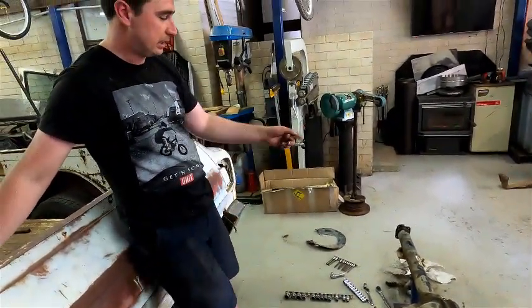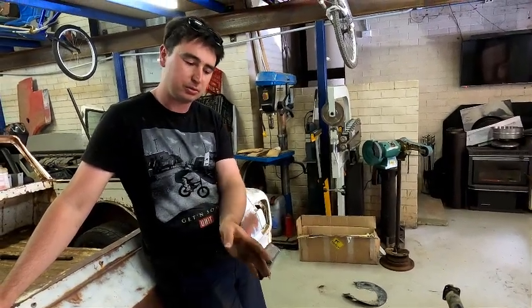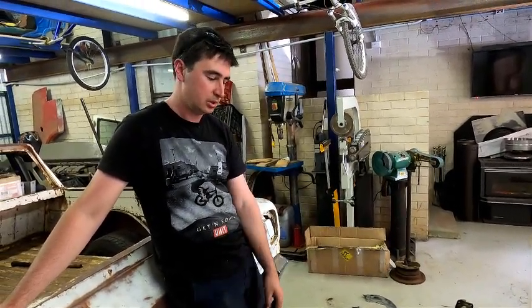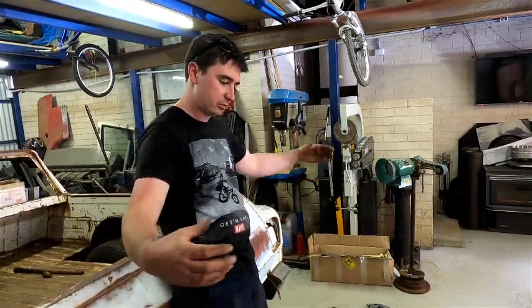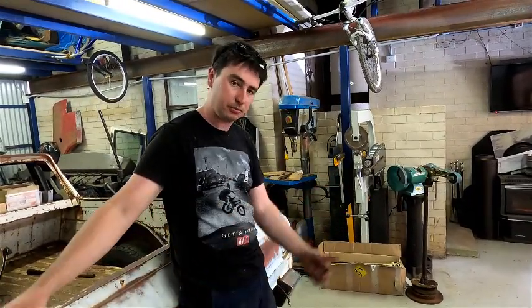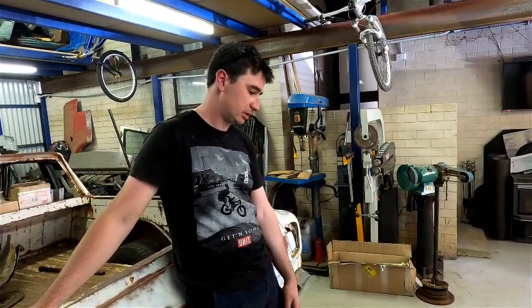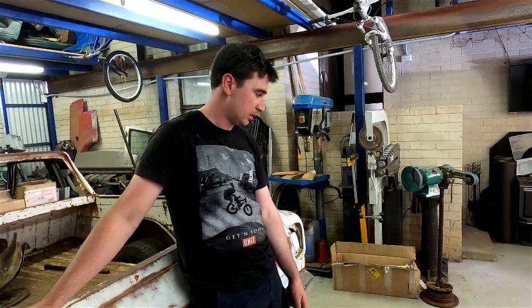We're then going to take the ends off to a machinist and see if he can machine the original bearing retainer out of the tube, because we'd like to then re-sleeve those back into the new axles and mount it, weld it all back up, and should be happy days. Pretty much per factory weld. Yep, exactly as it would be per factory.